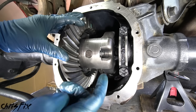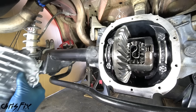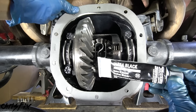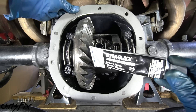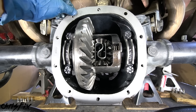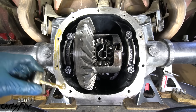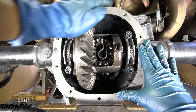Alright, we are almost done! Our differential is fully assembled, the clutches are in, and now it's time to install our brand new diff cover. With the gasket surface completely clean, you can either use a paper gasket or RTV gasket maker — I suggest the paper gasket, it's easier and inexpensive. The hardest part of using a paper gasket is aligning the bolt holes and keeping it from falling. So a little trick: remove the gasket and apply a little bit of gasket sealer — a tacky liquid that helps the gasket adhere. Apply a thin layer, then align the gasket and press down so it sticks.